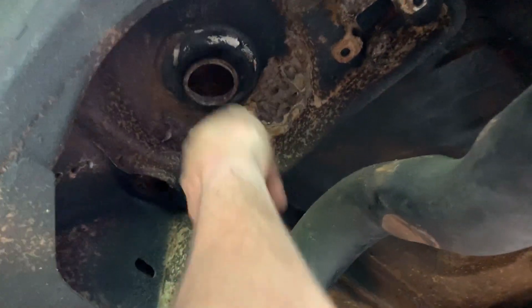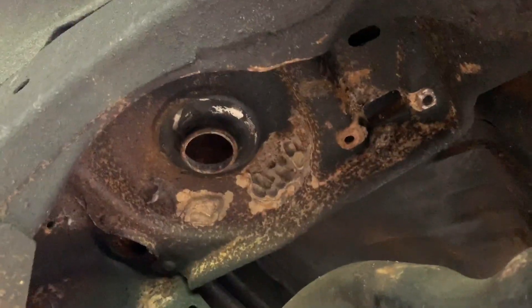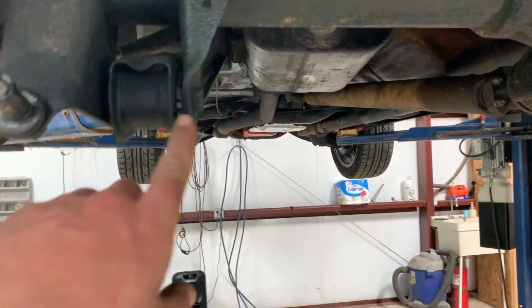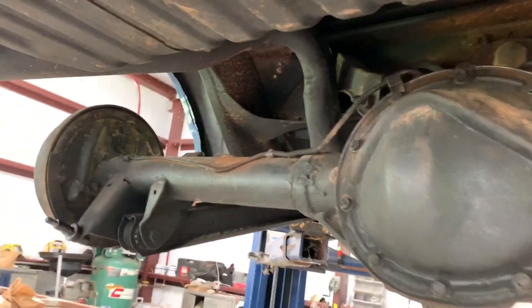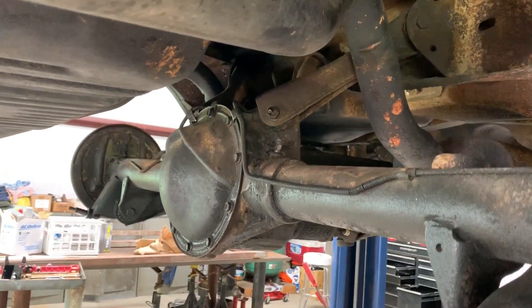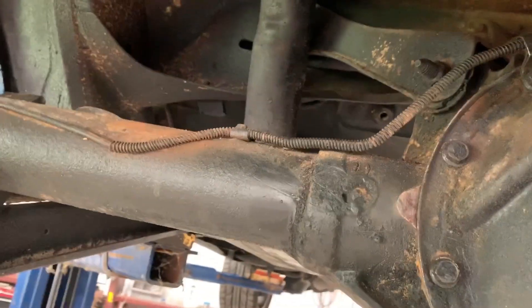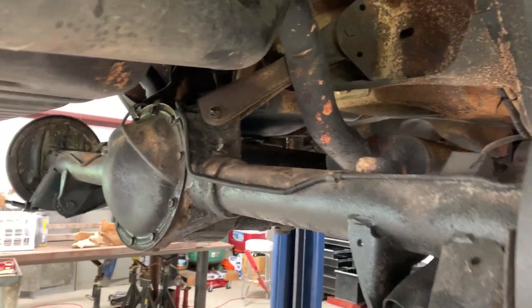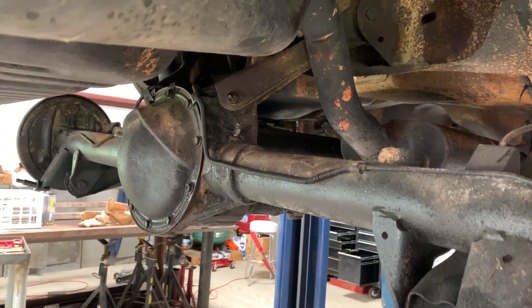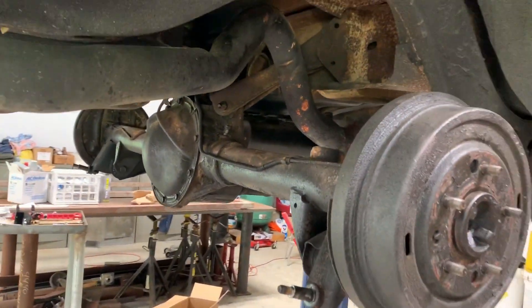You won't be utilizing anything up there. Make sure that insulator's gone off of there. I've got the springs out on both sides. Just to show you how shot this rear end is - that's just using up and down force and those bushings are holding basically nothing. But imagine getting on it and every time you give it a little bit of torque, your car goes yaw and does this just because the rear end is doing that. But that's what we're going to fix.